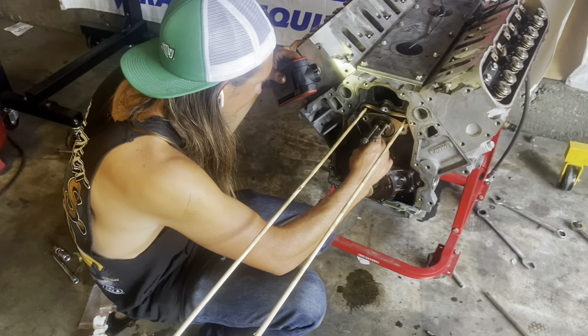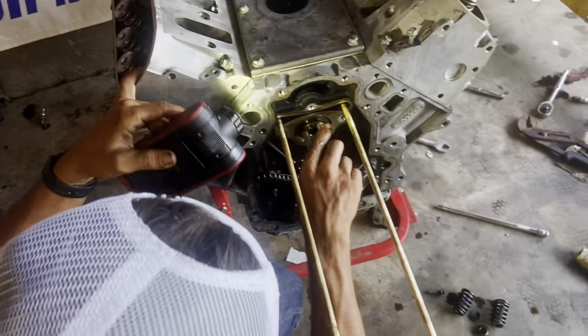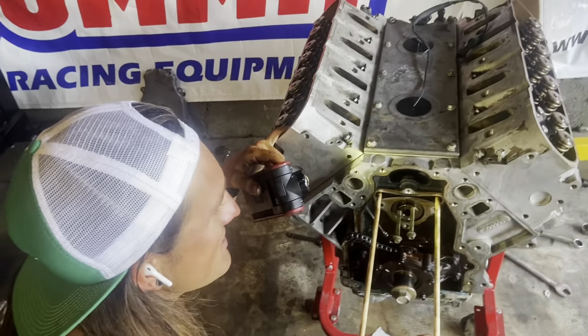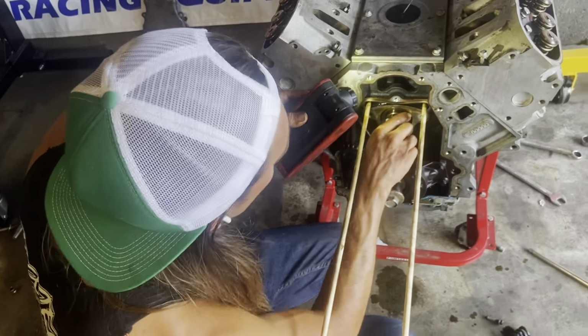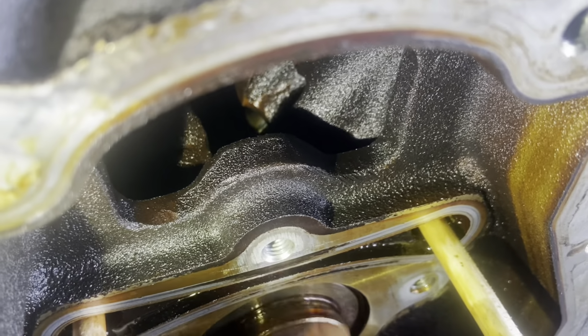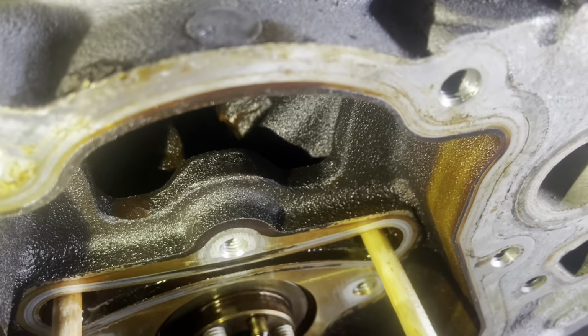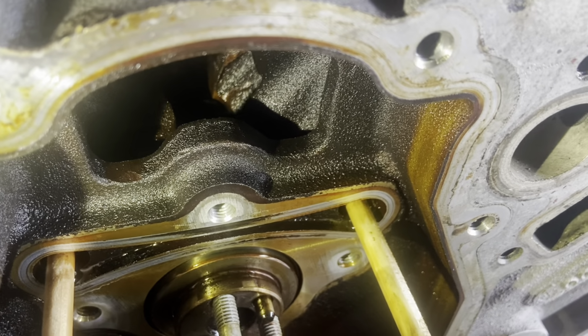An unfortunate turn of events. Travis, you want to show them? So basically, doing junkyard engines finally caught up with us. It's really hard to see. Can you try to get in there? So the trays, let's see. Oh yeah, right there. The trays are not holding the lifters at all, so there is no way to get them up in their bores and pull the cam out.